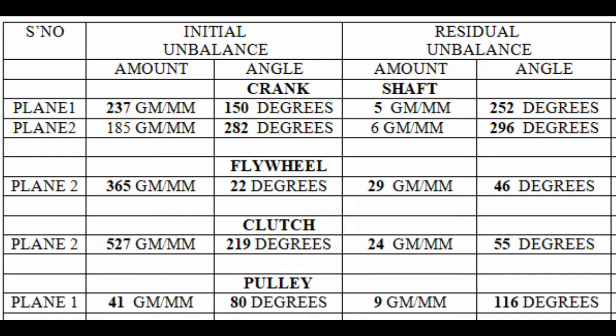The reciprocating parts — the rods and pistons — were all just matched. The pistons had the pins machined to bring the weights down to the weight of the lightest one. Because they're hollow pins, a small amount of material was taken out. On the rods, as you'll see in the next part of the video, they're basically balanced for overall weight and also balanced end-to-end.